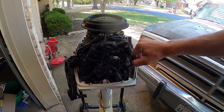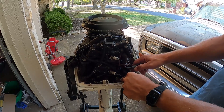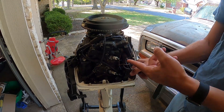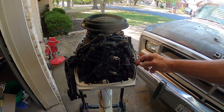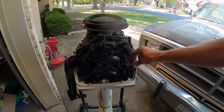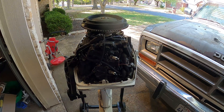We're going to lay this over on the side for right now and pull these plugs. How I'm gonna turn the engine over is with my drill. I'm going to pull these spark plugs because we're pulling them out anyway, and we'll check for spark with the plugs pulled so that way my electric drill can spin the engine over.